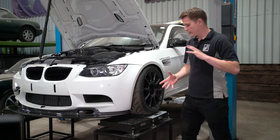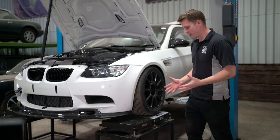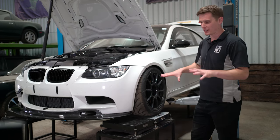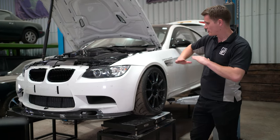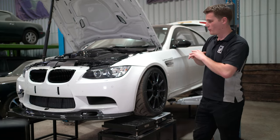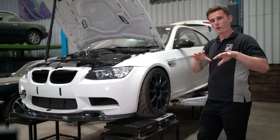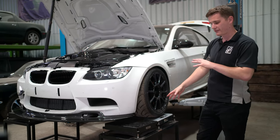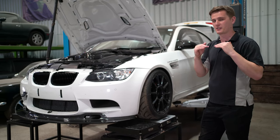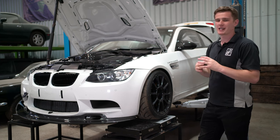When we're aligning cars we have them set on these four trays so we can make sure the car is on an exactly flat patch — we laser level these to make sure each square under each tire is exactly level with one another. When you align your car you want to get it as flat as physically possible. If you don't have that kit, find a patch of land that is as flat as it can be, maybe in a garage, to make sure your readings are as accurate as possible.